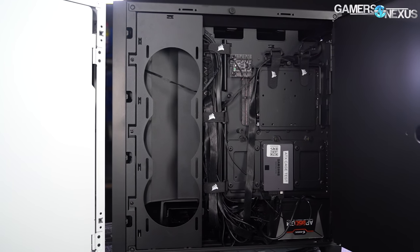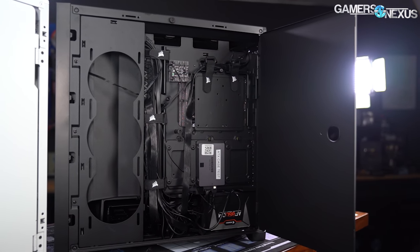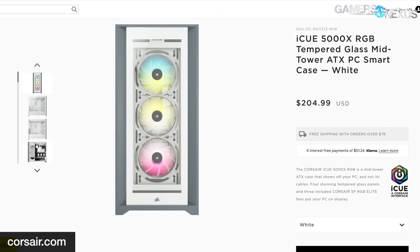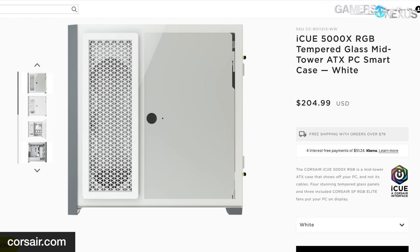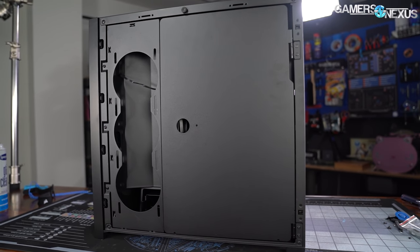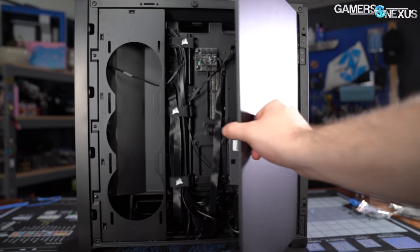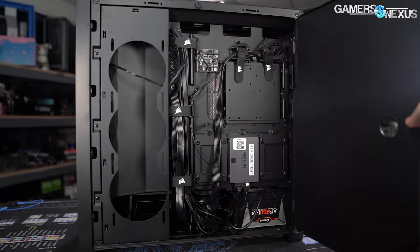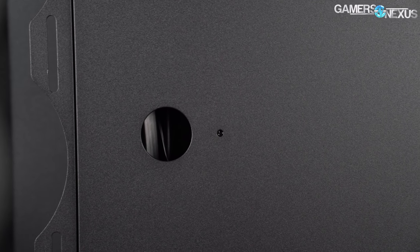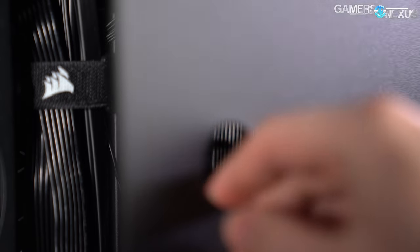The 5000D has a lot of unique features. There's a massive hinged cable cover behind the side panel, similar to the ones found in the gigantic Obsidian 1000D. It makes the motherboard side look really clean in the transparent 5000X, but it doesn't matter with the 5000D or 5000D Airflow, both of which have a non-transparent steel panel. In the 5000D, the cable cover is magnetic and the side panel uses screws — so the cable cover can be pushed open by cables, and the side panel doesn't need reinforcement.